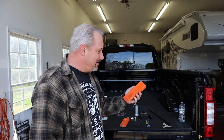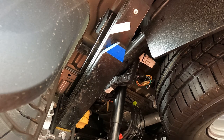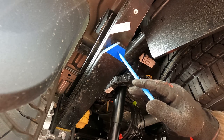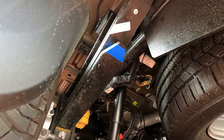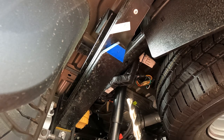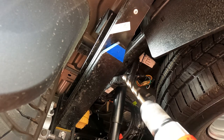Put a jack underneath — I'll show you how I do it. I'm also going to show you how I bolt these onto the leaf springs as well. So what I've done is I've put some painter's tape up here. I measured one inch back from the end of the spring, marked it, and then marked the center point to find where I'm going to drill. I'm going to use this 7/16ths cobalt drill bit and I'm going to start by hand, and then put a small floor jack underneath for some extra support and get it started first.